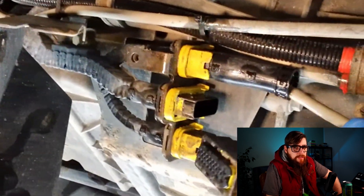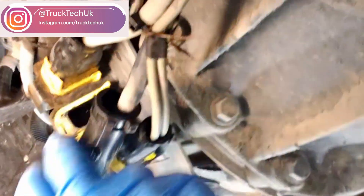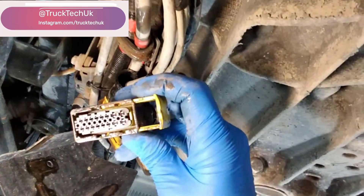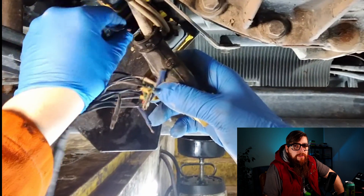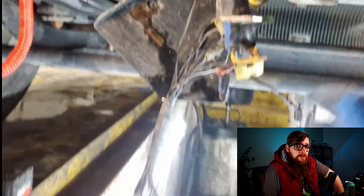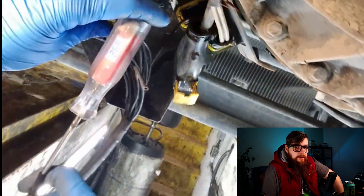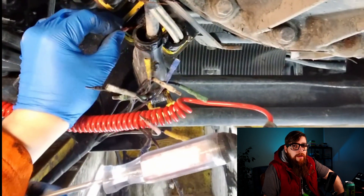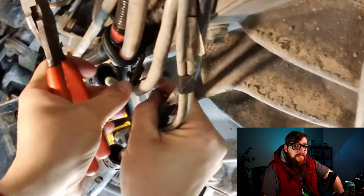To my surprise, the connector was nice and dry inside. So let's take some more voltage measurements. With my test lead in the plug and the wire identified — a tip here: if you take the cover off the back of the connector, the power and ground wires are completely different sizes to the CAN communication wires, which means you'll easily be able to identify the powers and grounds. With my test light in the plug, I can check for battery voltage on pin 4, and with 24 volts here, we have now identified the fault as being in the gearbox harness.